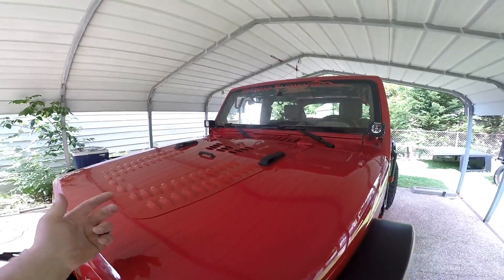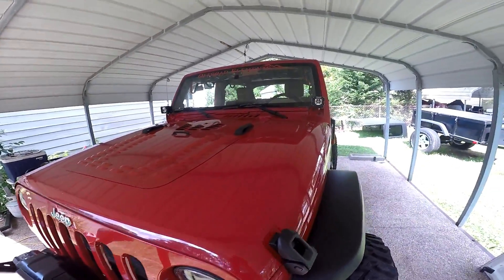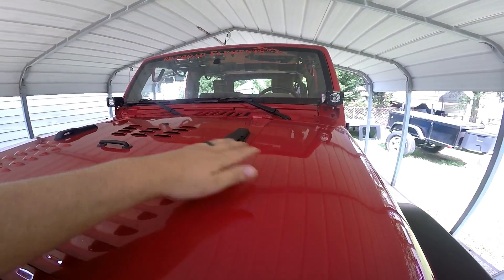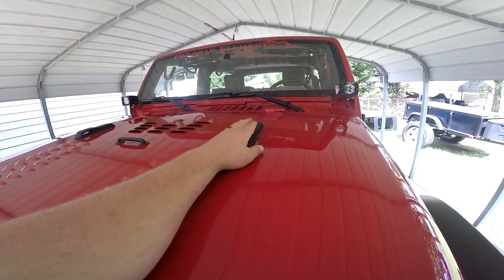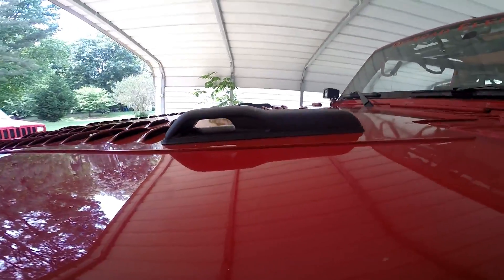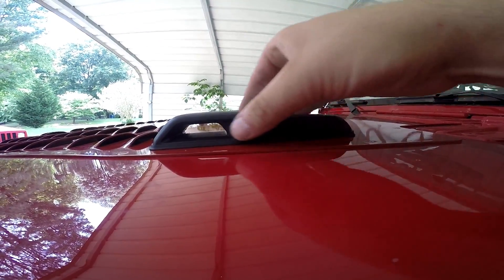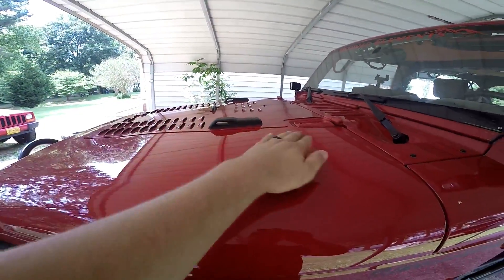They're both installed. Like I said earlier, it's just for looks — you're not getting anything out of it. But there's other people on the market that make replacements for the factory ones. There's like the Deletes that look like the little UFO ships — I'm just not a big fan of those. I think these turned out pretty nice. One little tip: if when you are tightening them down the back seems to be up a little bit, just loosen it up a little bit and make sure the stud is centered inside the hole through your hood. Then it'll mount nice and flush.